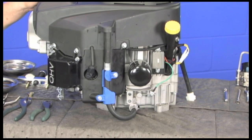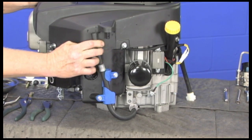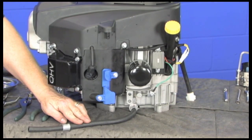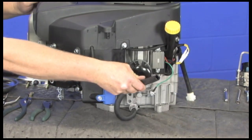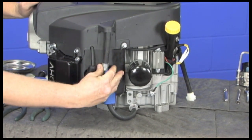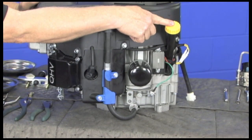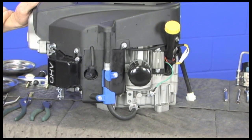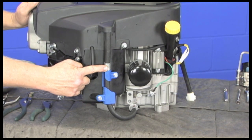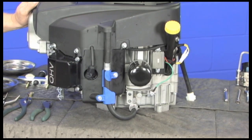One of the coolest features is the oil drain mechanism. The oil can be drained without the aid of any tools. The hose slips onto a fitting and is then captured by the zig-zag retainer bracket. When the oil is drained and the hose is reinstalled, you can simply remove and replace the oil filter, add the new oil, and the job is finished. You might say it's so easy a caveman can do it. The collar on the hose prevents the hose from being pulled off the fitting even if we snag a branch or a bush while mowing.